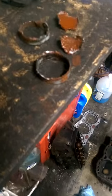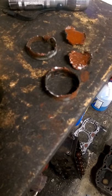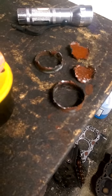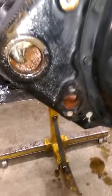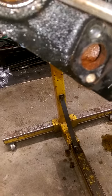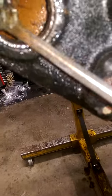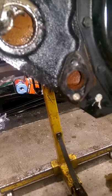You'll be left with just the outer ring sitting inside the bore - it becomes a thousand times easier to get that part out rather than trying with the center still in there. Let me pause and show you how to get that part out of the block without scoring your bore, without damaging the cooling jackets. It's actually very simple - you don't have to take a Dremel, die grinder, skill saw, nothing. I'm going to put the light on and show you.